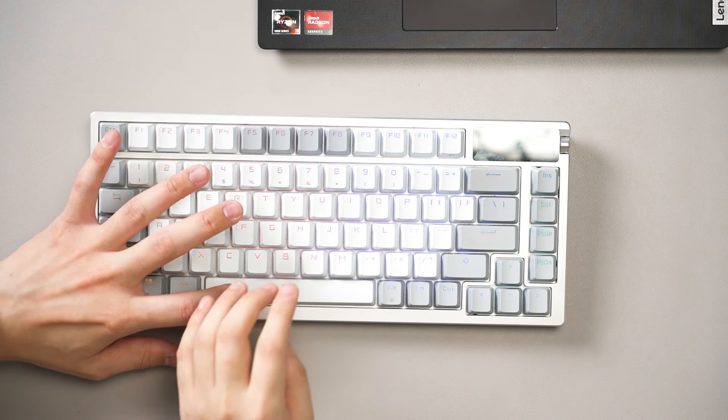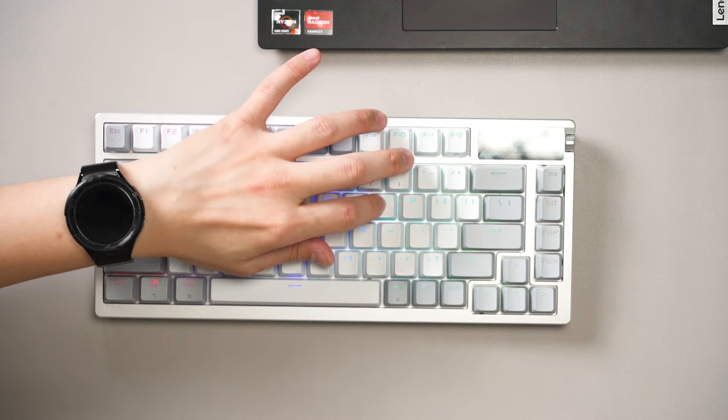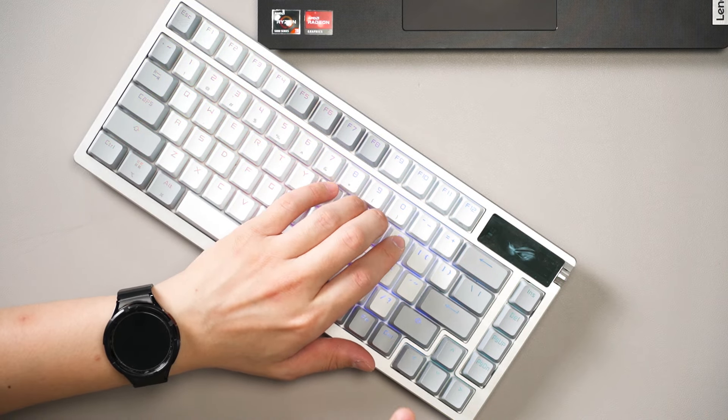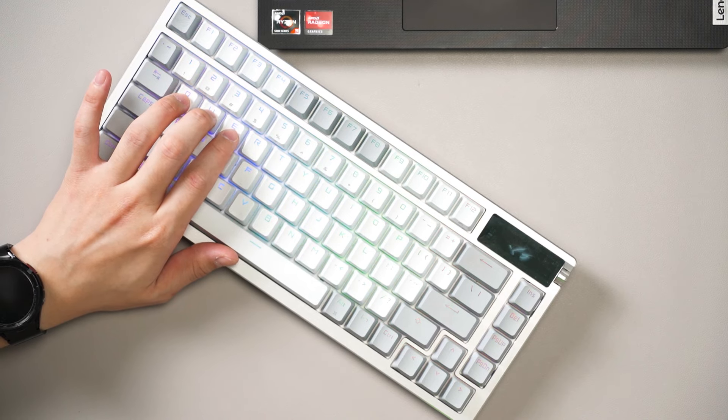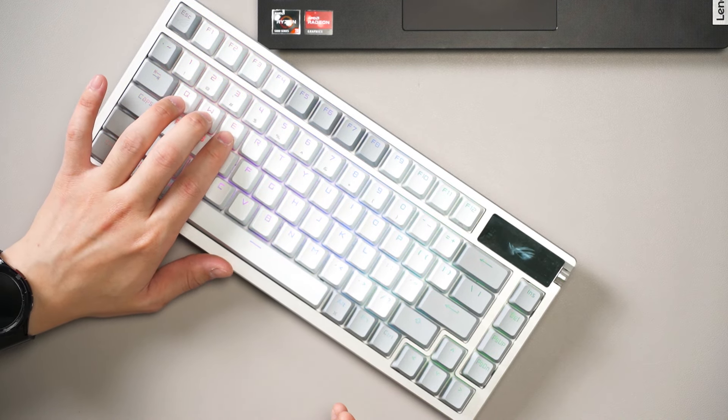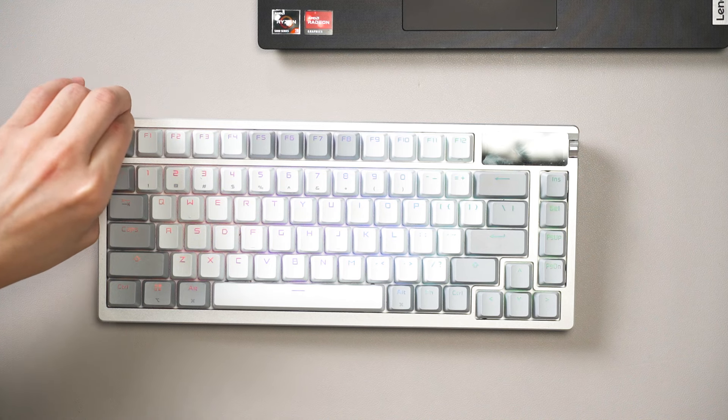Except the spacebar — it's sticking. Not sure if this is a lube problem, but the Azoth does have lubed stabilizers, so maybe it's just not well applied or there's a balancing issue. You can feel that especially on the U, I, O, P area — the factory lube is okay but still a little inconsistent. Certain keys feel sticky or slightly scratchy. If you don't mind, use it as is, but if you're OCD just lube them one by one.